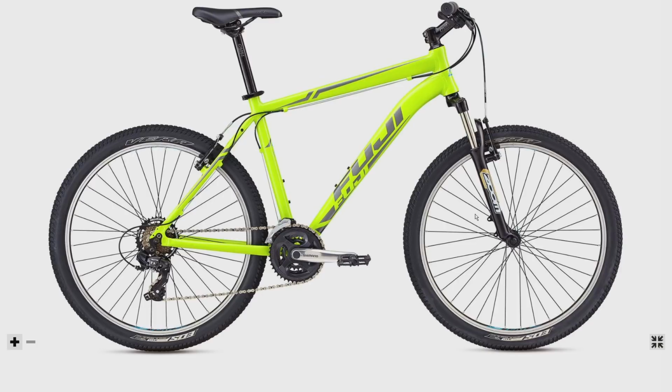Now, what you should not really look at is the disc brakes, because many bikes even for $200 have disc brakes. Awesome, I'm buying disc brakes. People, the V brakes will be much better than most of the super budget mechanical disc brakes. Okay, yes, I showed you a couple of days ago Tektro Spire, TRP Spire mechanical disc brakes, which are good, but these are not budget brakes and not for super cheap bikes. So don't simply assume that, okay, I've got disc brakes, this is more value.